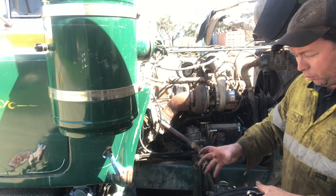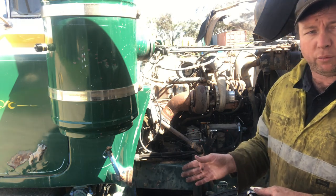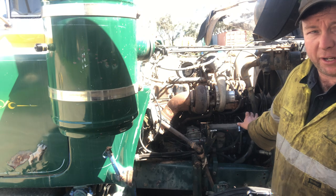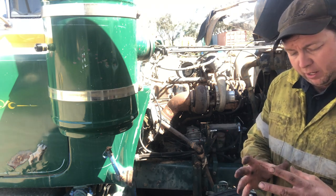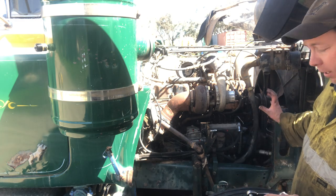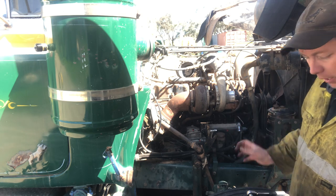So when you're fitting the pump up, if you're a little bit worried and you put the dowel pin, the special pin on the coupling, towards the bottom to make your job easier, don't be too stressed if you're a little bit out, right? Because there is only one way that you can couple the pump to the engine on that coupling, and then you can spin the pump separately or spin the engine separately with the front of it here.